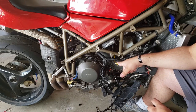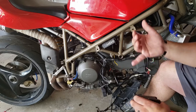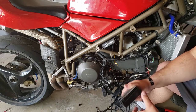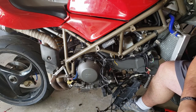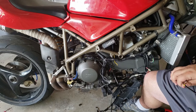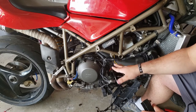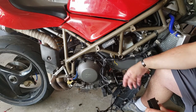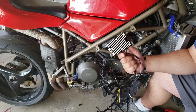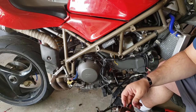but considering the voltage went up, I saw it on the multimeter, the voltage would spike up, the numbers were really high. It was close to 100 volts or something like that. It wasn't that high. I think it called for 70 volts at 6,000. Double check that before you listen to me. But either way, no matter what's happening, because this thing doesn't know what the engine's revving at, as long as I'm revving the engine, this son of a gun should start putting out direct current. And it's not. Neither is the new one.